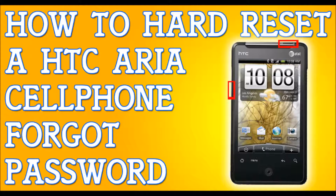Once your phone is powered down, we are going to be pressing and holding two buttons. Press and hold the volume down button and the power button. Hold these two buttons until you see the white screen with the Android logo come up, then let go of the buttons. You will be presented with your menu.